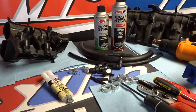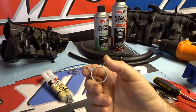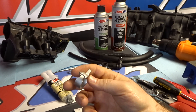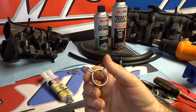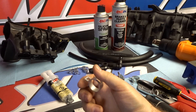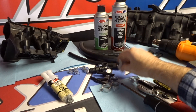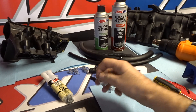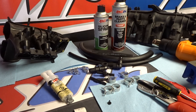I highly recommend you use these clamps. When installing, make sure you rotate them so the edges don't rub against something and start cutting into it. These are nice because they're OEM-style Dacromat-coated constant tension clamps. With the heat cycles on your engine bay these always provide tension, whereas worm drive clamps don't adjust based on expansion and contraction, so they tend to loosen over time.